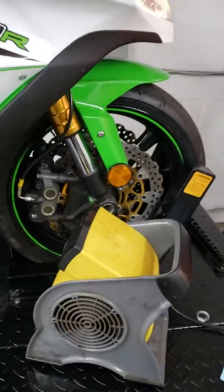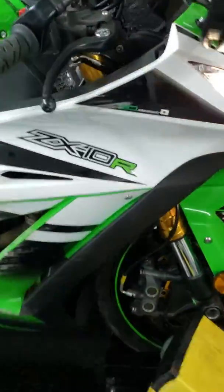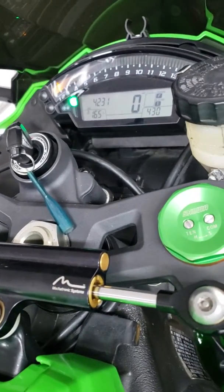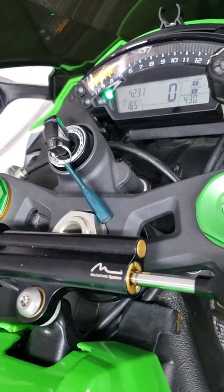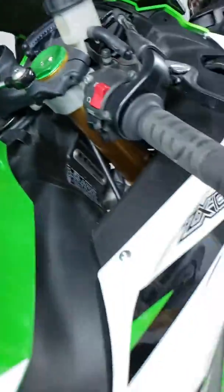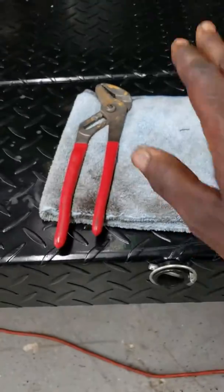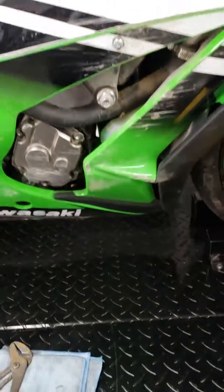So that's what's going on. I'm letting that air blow on it until I feel comfortable enough to cut it off. It's at 165 now. I'm gonna shut it off and see if it leaks — normally takes a while. I'll leave the fan running on the radiator so it can cool down. Got my rag just in case it starts leaking out. See what's going on — peace.